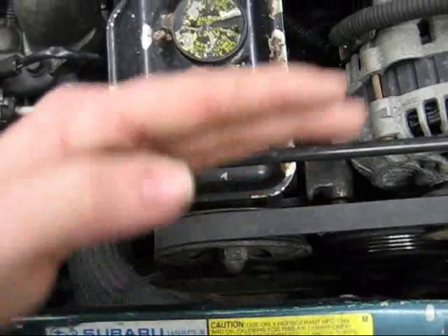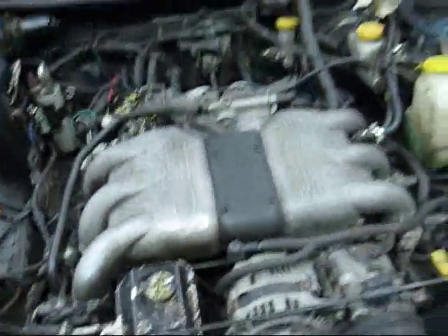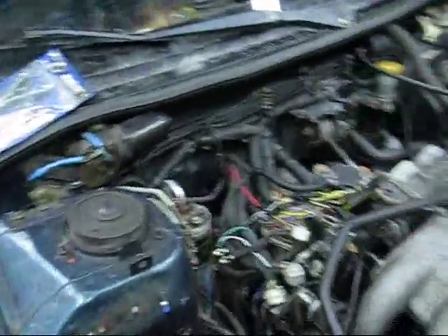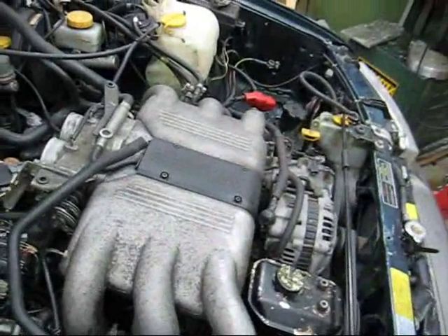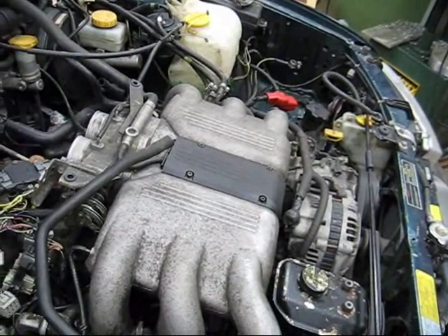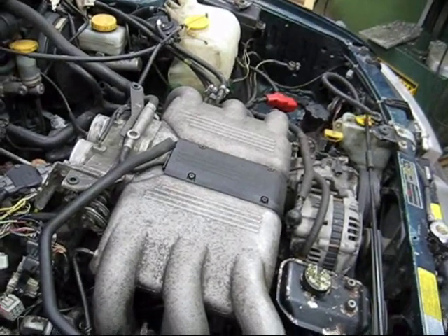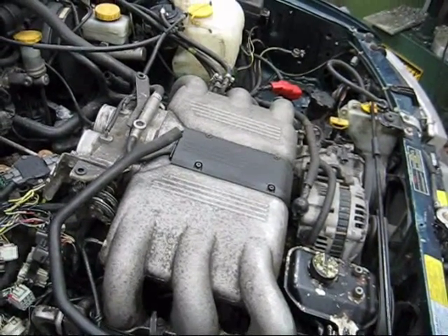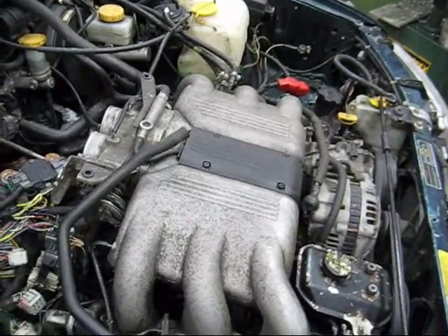This is one mod we're going to have to do — we're going to have to change the radiator's position. Because the rad is usually here; with the fans on my Forester it comes to about here, so it's not going to work. The EZ30 or EZ36 — which is a 3.0 or 3.6 liter — the only difference it has between the H4 and the H6 in later model years is that it's only an inch longer. The 6 cylinder is only an inch longer than the common H4 you find in a Subaru.